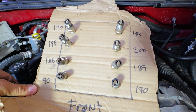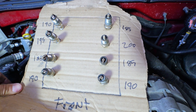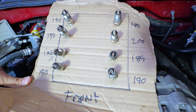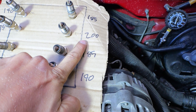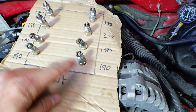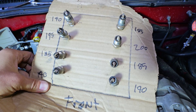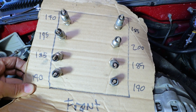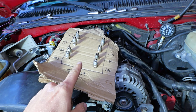Here's the results of our test right here — this engine's looking good. We got 185 up to 200 PSI. Readings are 190, 185, 195, 190, 190, 185, 200, 185 — they're all within about 10% of each other. That's the rule of thumb here. If you got one that's at 50 PSI and all the others are at 190, even 100 PSI difference, if they're wildly different, that one's got a problem. But looking at these test results, I'd say this motor's in great shape — blown head gasket, worn piston rings isn't a problem with this engine. These are great test results. Shoot for 200 PSI. This motor has 170,000 miles on it and I'm impressed with this result.